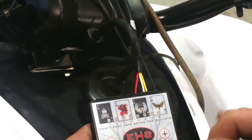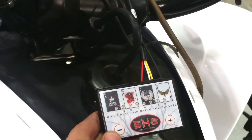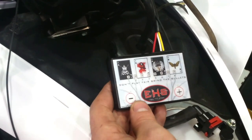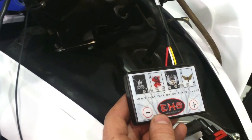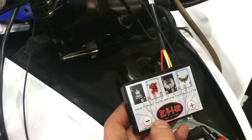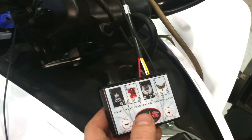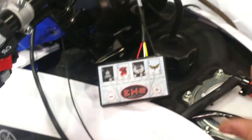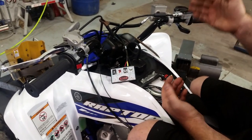The next three modes after that are going to be green-and-blue, yellow-and-blue, red-and-blue — those are going to handle fuel timing. For the most part, for all our kits, you're not going to have to adjust those at all. They have to do with a throttle position and RPM-based math equation — how much throttle position at what RPM you're getting, jumping from circuit to circuit. But 90% of the controllers we do, the green-blue, yellow-blue, and red-blue are all handling the low side switching point. The green-blue is the one you're always going to have to change the most. If your bike has a sporadic idle — kind of jumping in between add fuel and not add fuel — you lower it down and it's always adding fuel. You raise the green-blue up and it's a higher RPM where it's not adding fuel, so it's running on stock pulses.